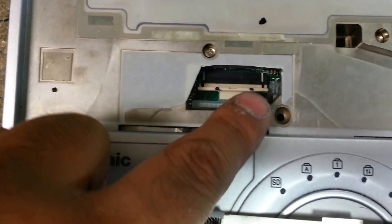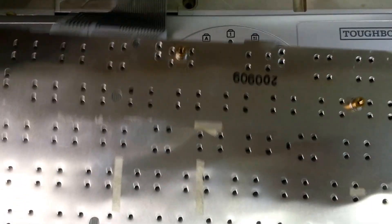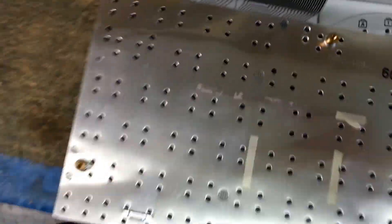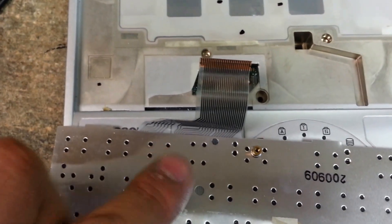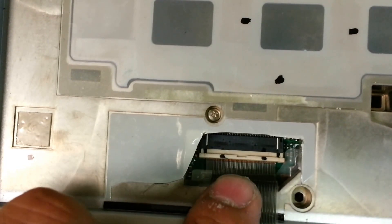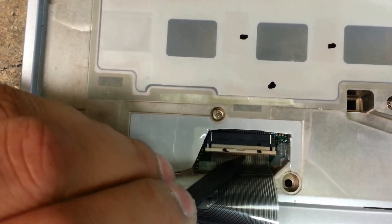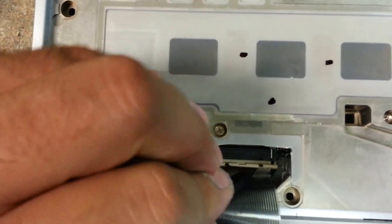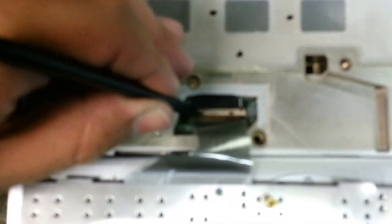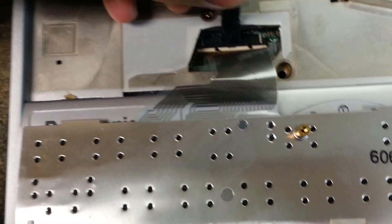How are you going to replace this here? Get yourself some Kapton tape, pop this, put it back on there, and just put some Kapton tape right over it — that's a heat-resistant tape. To put this on here, it's a little bit harder to do one-handed, so you kind of just wiggle it in there like that. Take your pry tool and shove it in so that it's nice and tight, and while you're holding it — once you get it nice and tight, flip over to the flat end of your spudger and push it in.